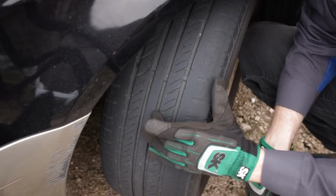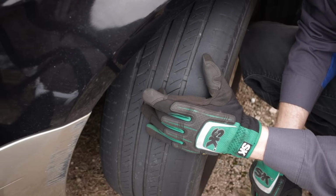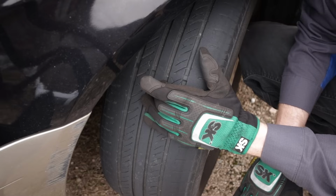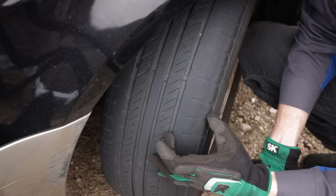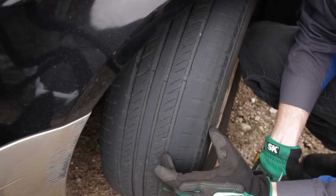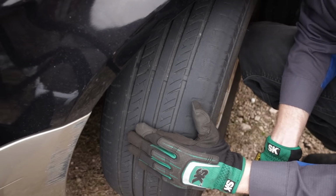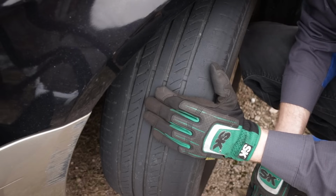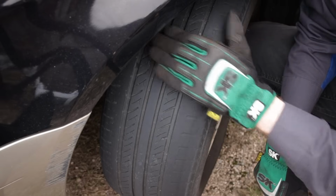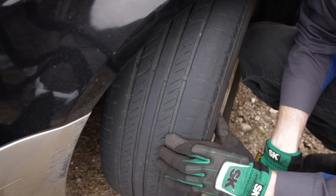So yeah, these tires still have a decent amount of tread in the middle. I think it was about 6/32. They're not down to the dangerous replacement level, but due to the wear on the outsides of the tire, the pieces that have pulled out and the dry rot, these are way past time to be replaced. So the old LL Bean at 300,000 miles is gonna get a new set of Michelin tires and a new set of Subaru factory struts.